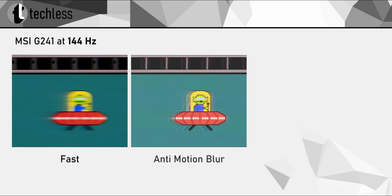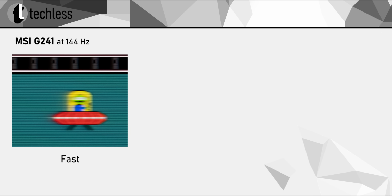There is also an anti-motion blur option that disables FreeSync, overdrive and brightness control. The latter leaves us with a quite dimmed down brightness setting. This mode obviously gets rid of motion blur quite effectively, but as there's no overdrive anymore, the ghosting gets pretty intense. I surely don't enjoy gaming when every object or enemy trails multiple sharp ghost images behind. So ghosting and the other drawbacks are just too much to recommend using this feature. Let's leave anti-motion blur aside and pull up some comparisons.